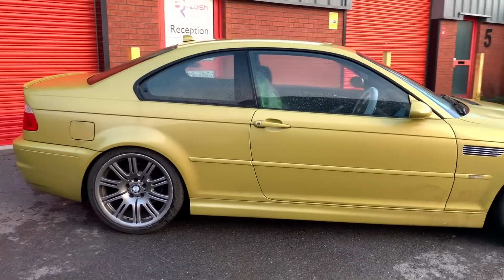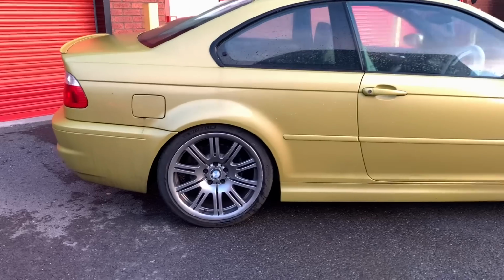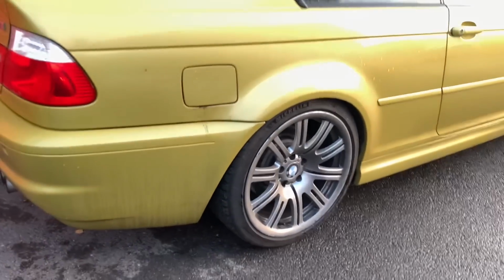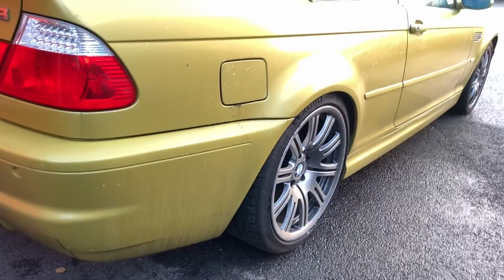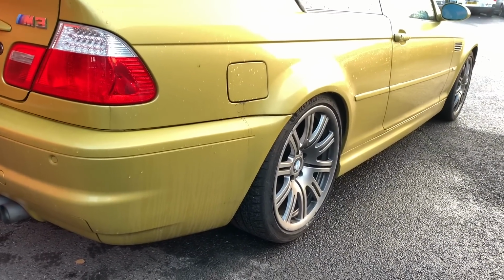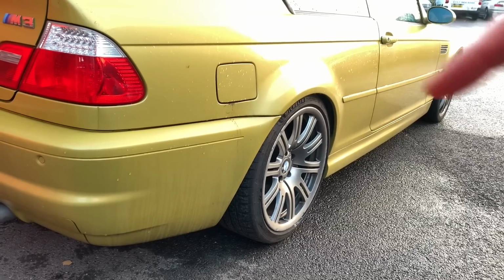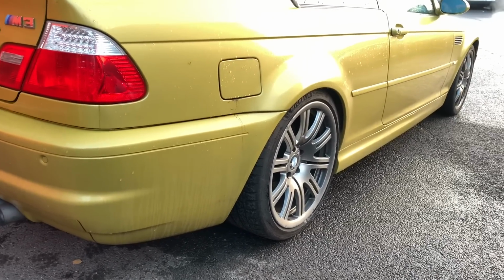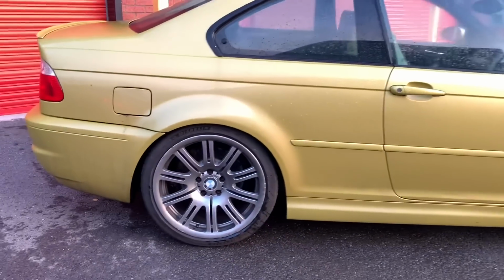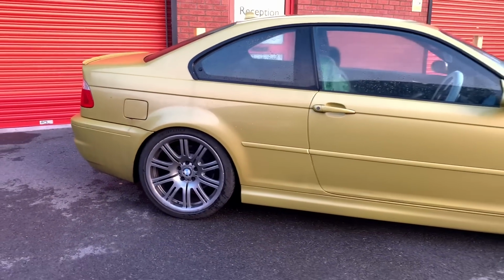It's already been for our RACP Check Report, which is where we look at the underside and mechanical condition, especially the RACP, including the borescope camera inside. We found several cracks and problems, not only with the external but also the internal sections, and it's also got wheel arch corrosion on the inside, which is getting a bit more common. So it's time to come in for a refresh, and the owner wants this brought back up to a good standard mechanically and also for corrosion prevention.